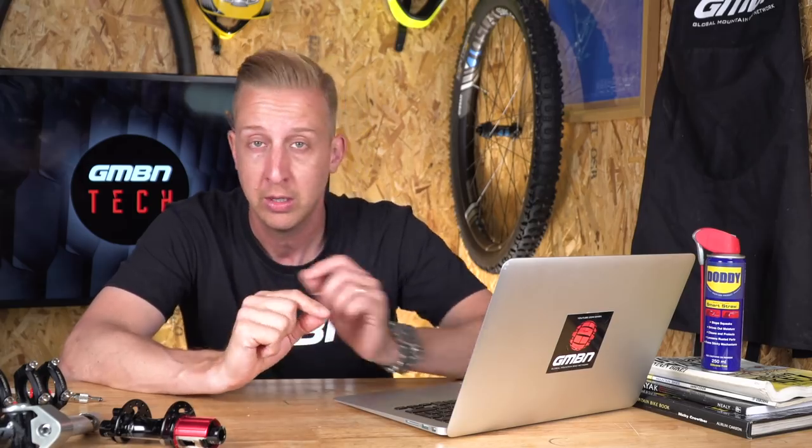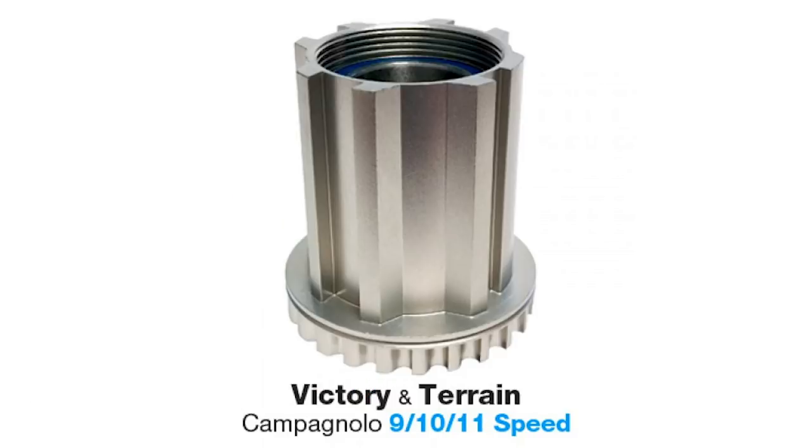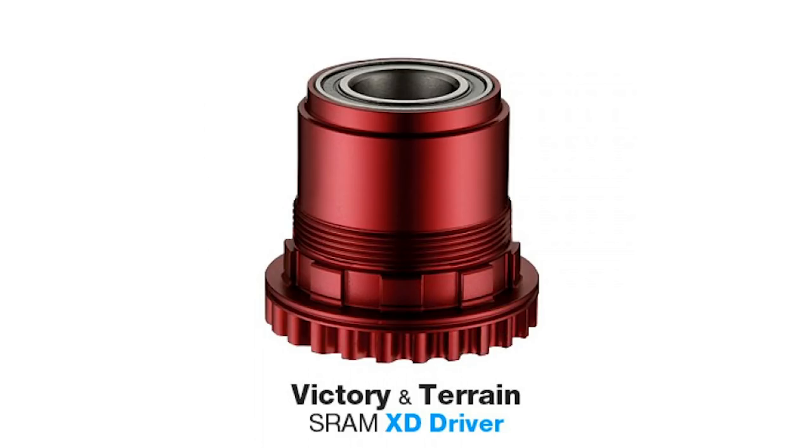The best bet after a while is to get a new freehub body. There are brands on the market that make ones with a steel insert. The one on screen now is by American Classic — it's an aftermarket product available for various hubs and has a steel insert right where the torque tries to rotate the cassette and cause damage. You might wonder why you can't just rotate the cassette to the next set of splines — it's because there's a master spline that ensures sprockets are oriented correctly so the chain ramps line up for shifting. Filing helps in the short term, but long term you're going to need a new body.